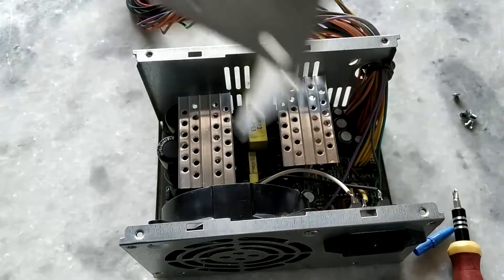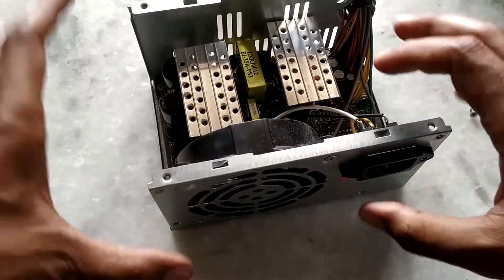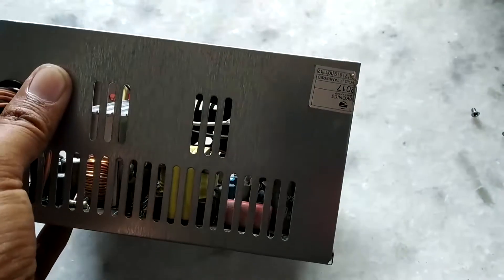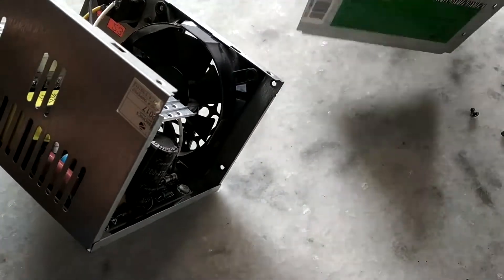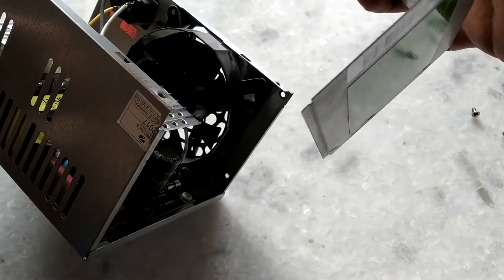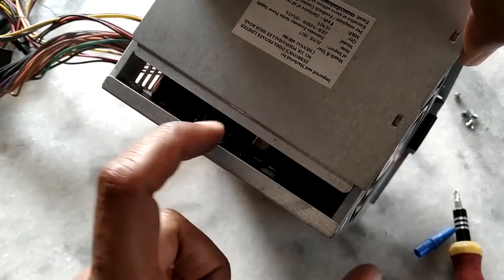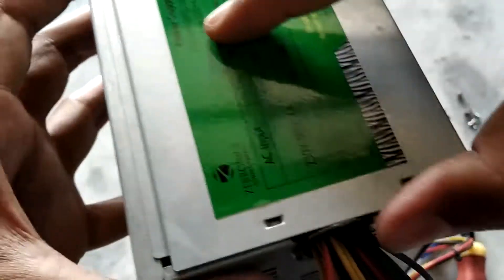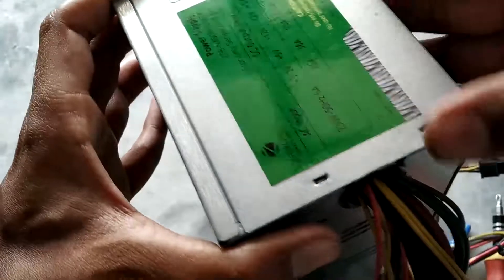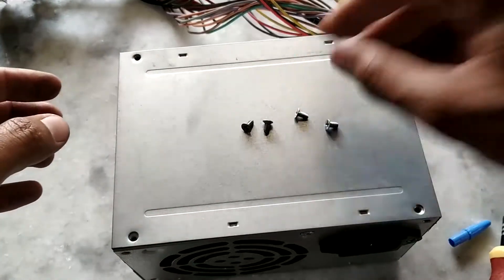Let me rotate the fan again so you can see it is now rotating properly. Let's put the cover back on. Before you do, clean it with a rag as well. Sometimes when putting the cap back on people forget the correct orientation. To figure it out, find the warranty sticker on the cap and match it with the hood. If I put it one way there's no sticker visible, but if I flip it the sticker lines up — that's the correct orientation. When putting the cap on, make sure the top cap goes under the bottom part. Do the same from the other side, then screw back the screws we removed at the beginning.